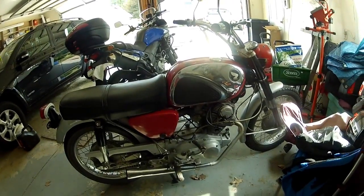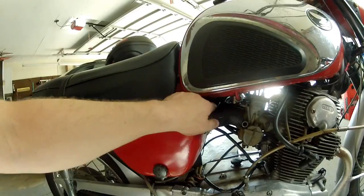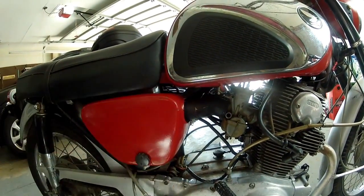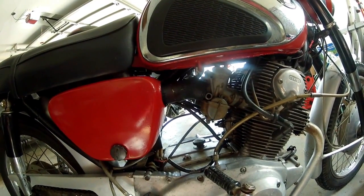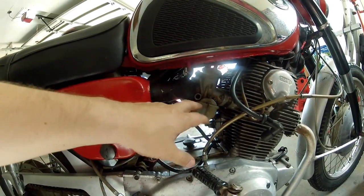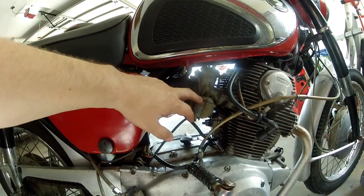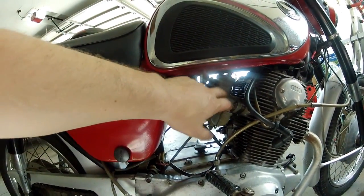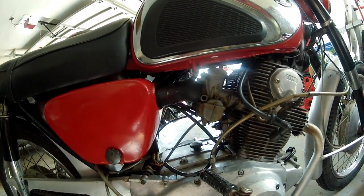I hope I don't have a problem with the clutch down there. Look at the cracking of the intake tube here — there's probably air leaking like crazy in that thing, and that'll need to be replaced, the other one as well. The carb of course — it's a Keihin carb — will have to be pulled and restored. Basically you blow out the jets and soak the whole thing in Pine-Sol, replace the rubber parts, and remount it to the engine.